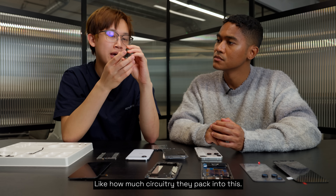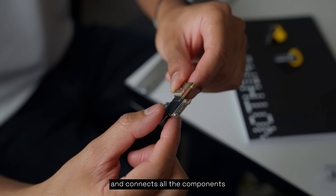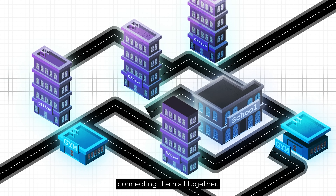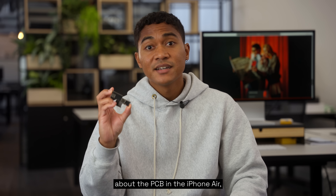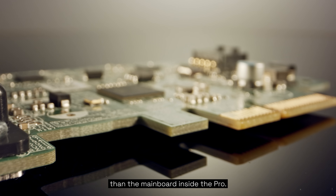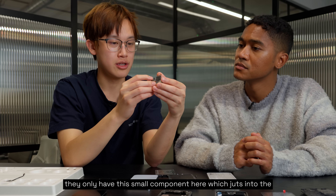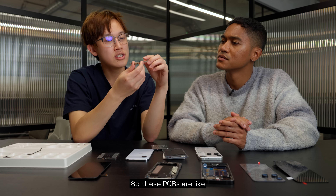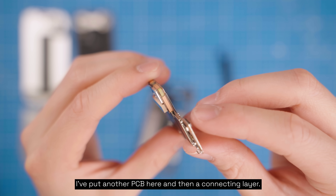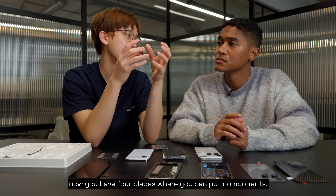The part Patrick is holding is called the printed circuit board — a very important part which houses over 100 meters of copper and connects all the components in your phone to one another. Think of it like a small city: components are schools, gyms, workplaces, and the copper traces are roads and pavements. The PCB in the iPhone Air is remarkable — it's the size of a stick of lip balm, yet has a bigger surface area than the main board inside the Pro. The Pro's PCB is fully double-stacked, whereas in the Air, only a small section jutting into the camera bump is double-stacked. Double-stacking means layering two PCBs with a connecting layer, giving four surfaces for components instead of two.